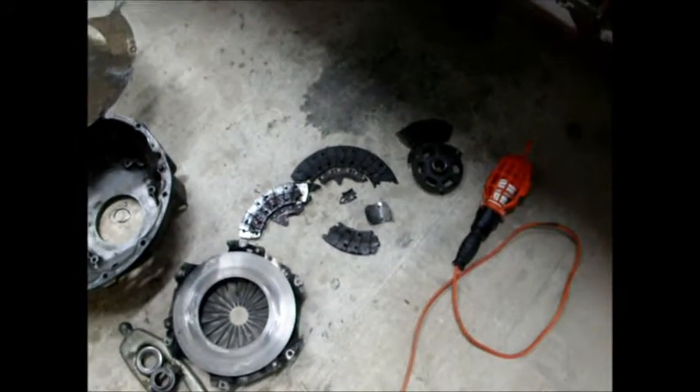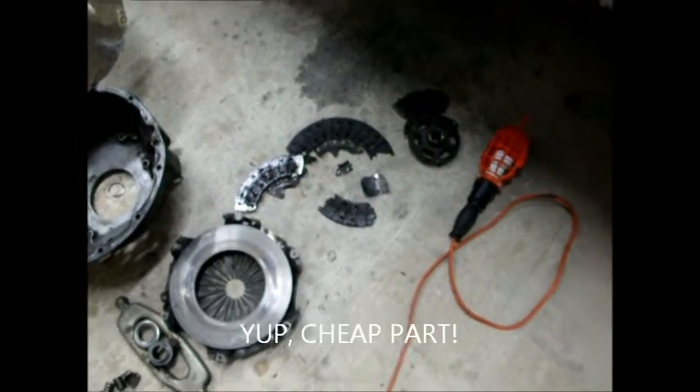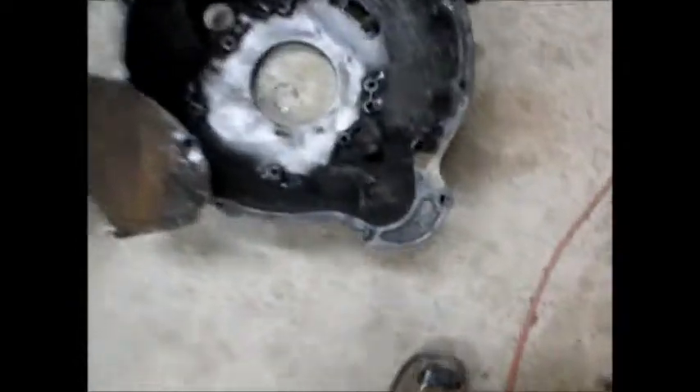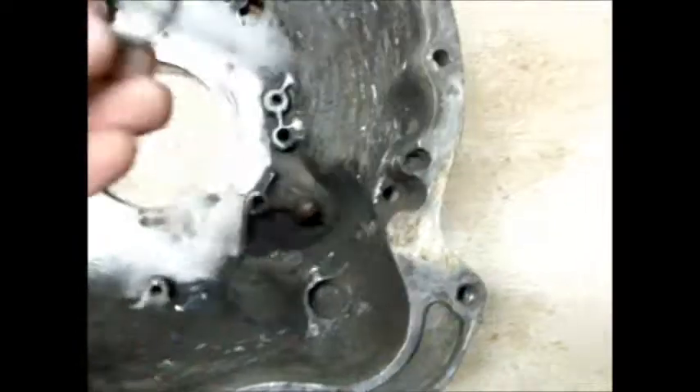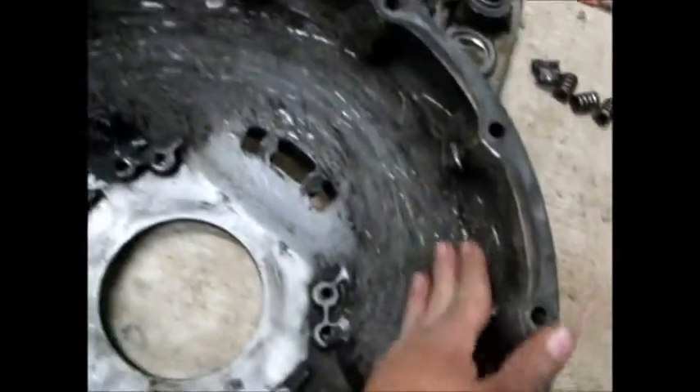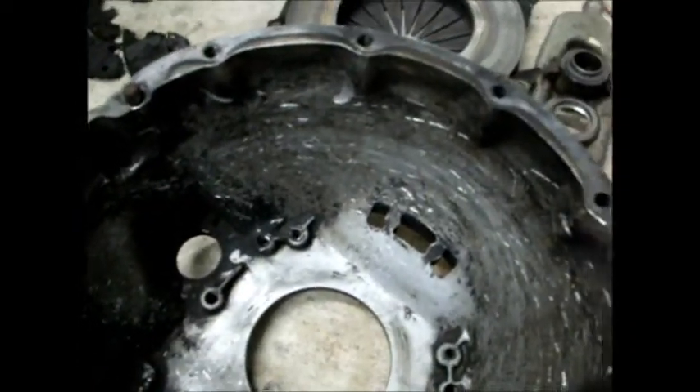And yes, that is probably a cheap-ass AutoZone replacement clutch. Here's my bell housing. Here's pieces of the throwout bearing. You can see it had that piece of that starter and all that stuff flopping around in there — that's why I quit driving it. Look what it did — it marred that thing up good.